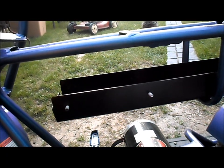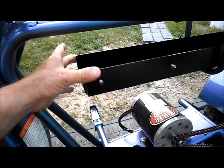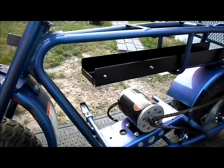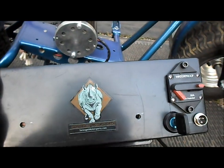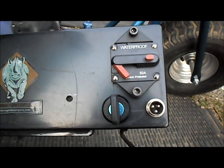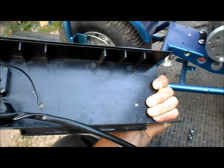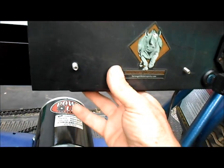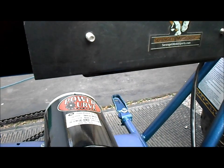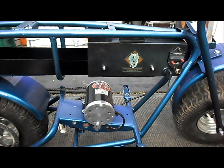Then we'll put it all in right across from there. We'll have a couple of front covers on here that'll have some of our electronics. Here's part of our battery box — I trimmed it up. It'll still be a battery box, but I added a 50 amp circuit breaker, an on/off switch, and our charge port. And we'll get it up here onto the battery box. Our battery box slides right on our studs here, and we've got a couple of acorn nuts we'll secure it down with.